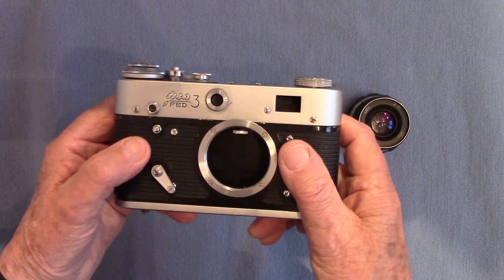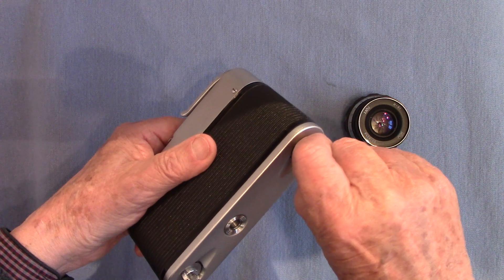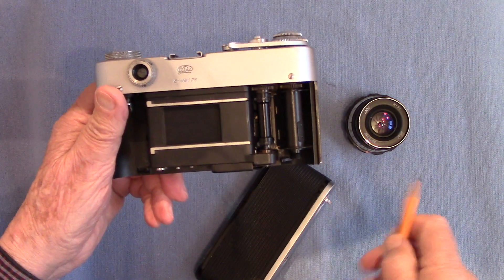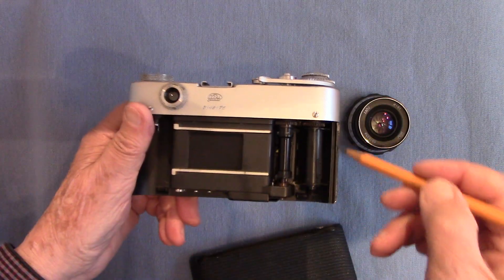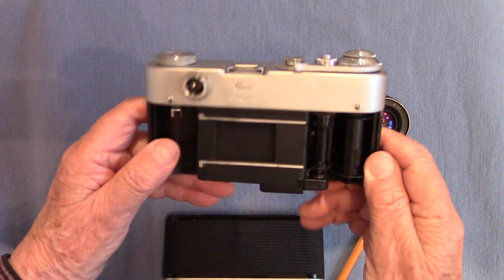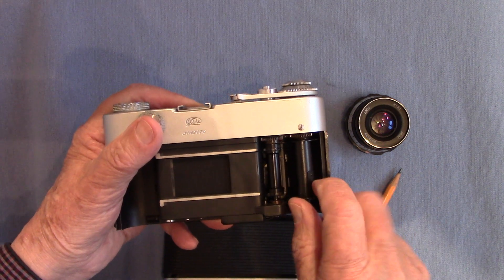What I found is this one had difficulty opening the back. I had difficulty getting the latches in the right position before the back would come off, but now I've managed to get it in the right position and the back comes off. I put a little drop of oil on a piece of cloth and wiped down the metal here where it pushes in to close the back - a very minute amount of oil. It's very old now, from the 1970s or early 1980s, and had never been serviced, but it's in very good condition. This is the spool take-up here where you put your film leader, and it's removable.